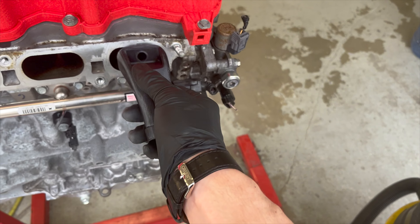Here's a final look at cylinder one after some more picking and blasting. It's not perfect, but it should be perfectly fine. Ideally you'd want a wand that can go further down through this opening — you'd get a lot more off that way — but I don't have any extension for this right now. It's definitely working good enough, so I'm going to leave this as is. That's cylinder one, and then we're going to remove this and start working on the other cylinders.